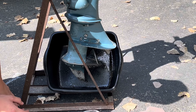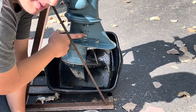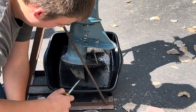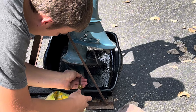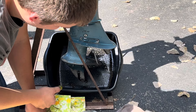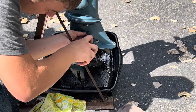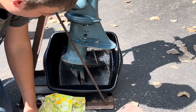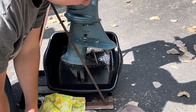I'm zooming in on the lower unit of my outboard. You'll notice here on the left side of the outboard there are two screws — one says oil vent and one says oil drain. So first I'm going to take my flathead screwdriver and bust loose and remove the oil drain screw. You'll notice your oil will start to come out. Mine does look like gear lube that's been used for a while, so it needs a change. Now I'll go ahead and open up the vent and it'll come out easier. You can see it's coming out in more volume and so far it's looking how it should, so I'm glad. That means all my lower unit seals are good, there's no water, and it looks like used oil. Go ahead and let that drain for a few minutes.